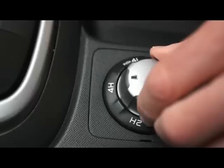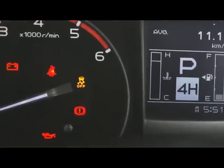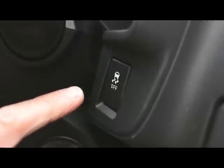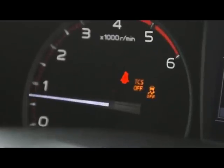For the more serious off-roaders, the way it works is as follows. In high range, a short press of the traction control button will deactivate the engine torque reduction feature of the traction control — this is done automatically when low range is selected. Further to this, a longer press of six seconds will deactivate the whole system, including the brake traction control.